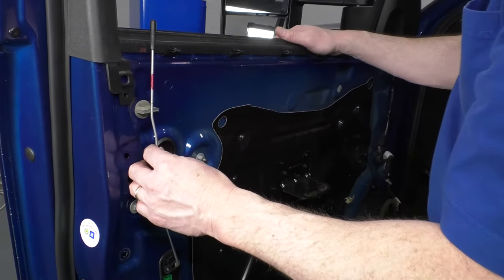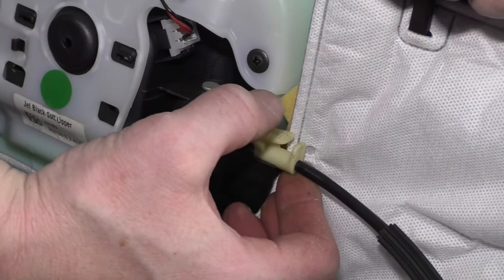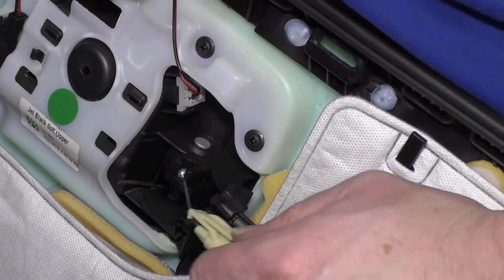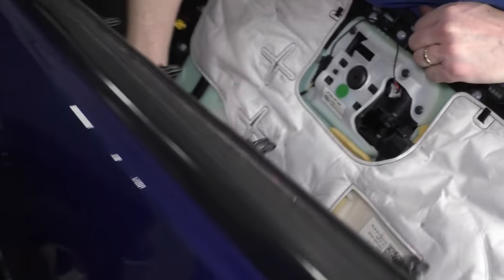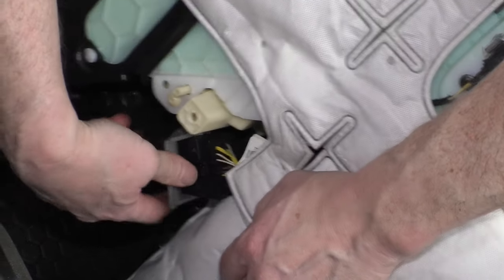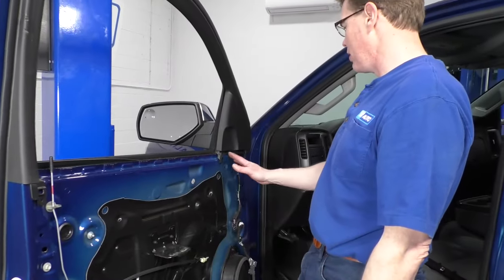If your door lock fell out of place, just put it back up into place. Release your door handle cable by pressing down here and then pulling back, then work it around, pull it up and out. There's a single electrical connector here — push on the black tab while you pull up on the gray tab, then bring the gray locking tab out and that unlocks.